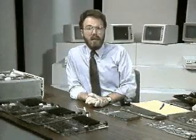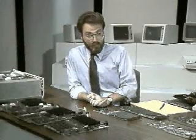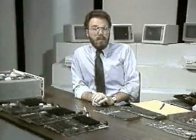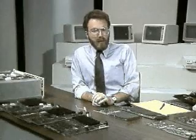The clock is to a computer what a metronome is to a beginning piano player. It sets the pace for the system. There's another characteristic you need to know, the data path. The 8088 has an 8-bit data path. Now, 8-bit data path means that the doorway to the outside motherboard and expansion circuitry is only 8 bits wide.